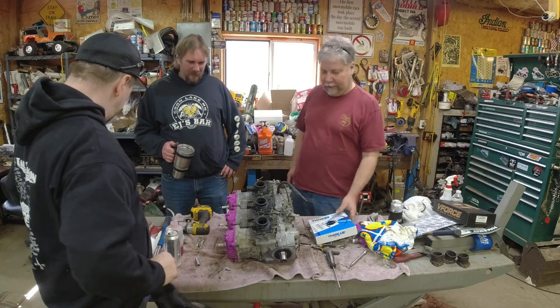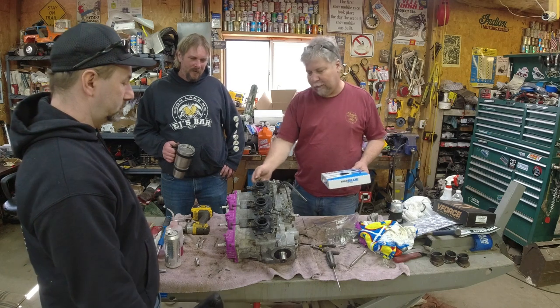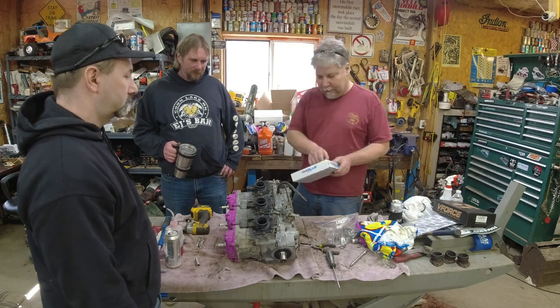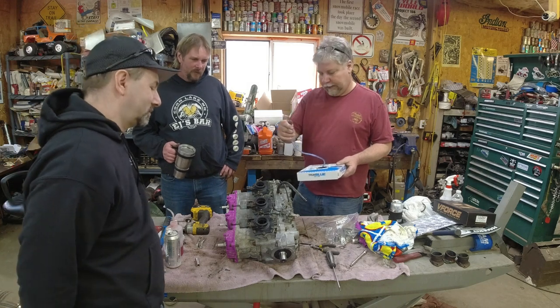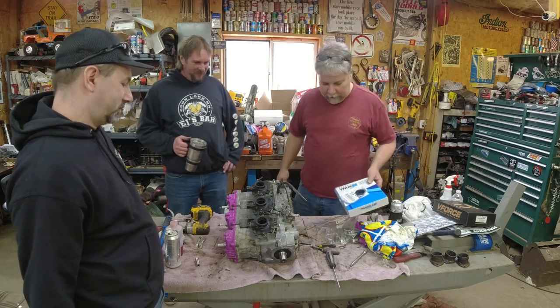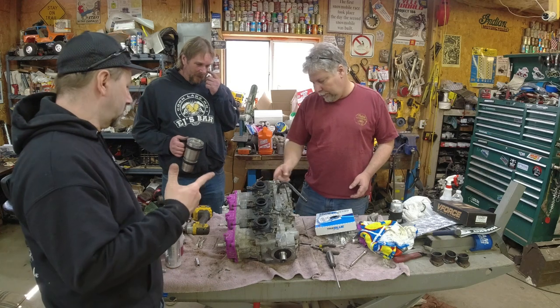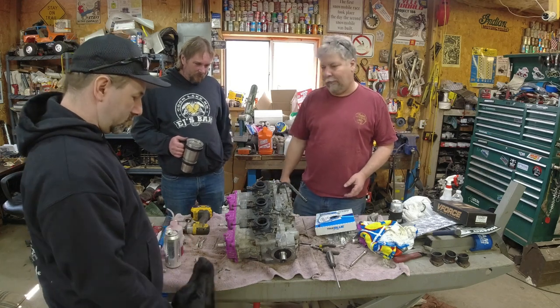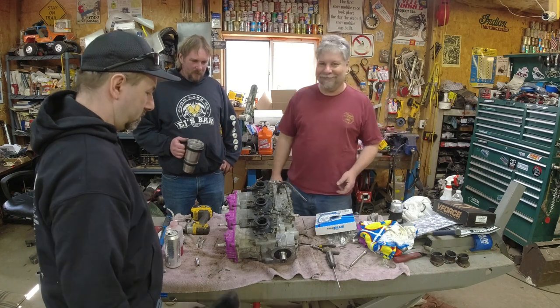All right, things are coming together. These fittings, you probably know, they're on bolts. You can tighten them, you can loosen them. They're little banjo fittings. So next thing we're going to do is new oil lines. Why new oil lines? Why not new oil lines? Why not? It's here. We're going to get the motor straps on, and then we're going to worry about the stator and the flywheel pretty soon. She's shaping up. She's starting to look like a motor.